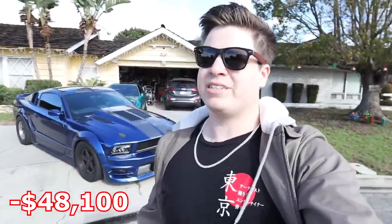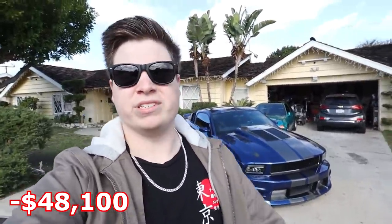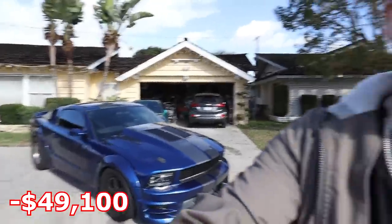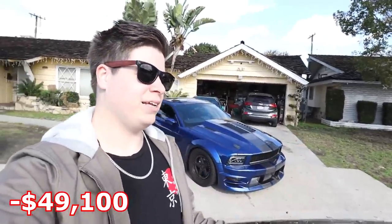I took my car to a new tuner I still go to today — Addiction Motorsports out in Simi Valley. With just a simple tune and the correct pulley, we gained 150 horsepower, putting the car right around 700 wheel horsepower. But I wasn't done yet. From there I bought a set of Comp Cams Stage 2 blower cams, which really woke it up — that put us right at 770 wheel horsepower. A little tiny three-valve making 770 was crazy. A lot of people didn't know what to expect getting dusted by an '06.